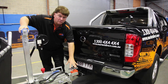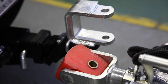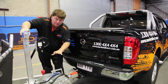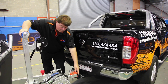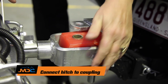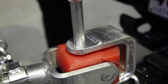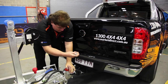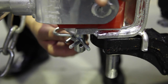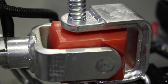Major components of the polyblock are: the polyblock coupling itself on the trailer, the hitch receiver that goes onto your vehicle when you're picking up, the pin that goes through, and the two safety pins that engage it. I've already levelled the trailer so the polyblock will pull in from the side, but typically you'd back up, level the trailer up, then it's simply a matter of pulling the connector across, lining the hole up, pushing the pin through, and taking one connector in, then the second one. It's as simple as that, folks. Now we're ready to go on with the rest of the connection of the trailer.